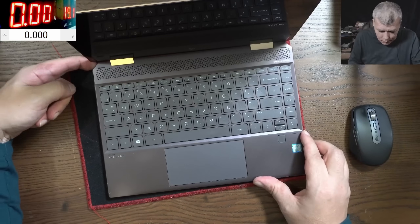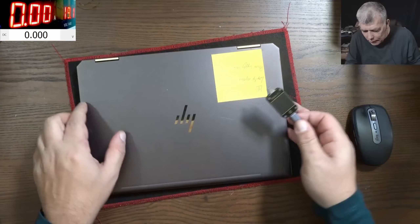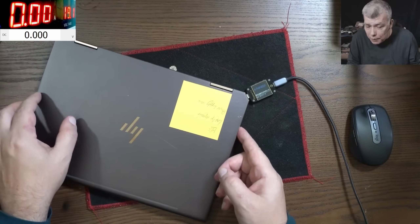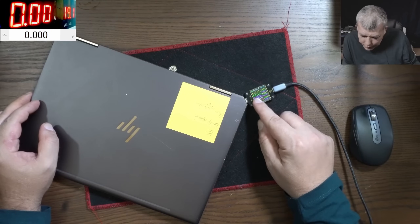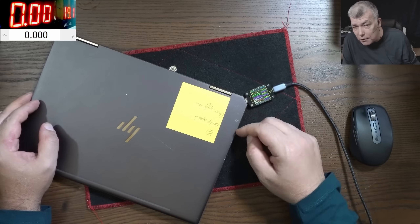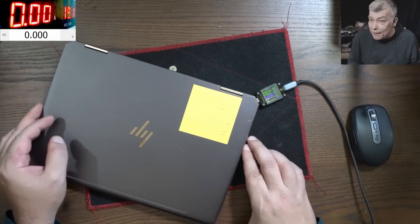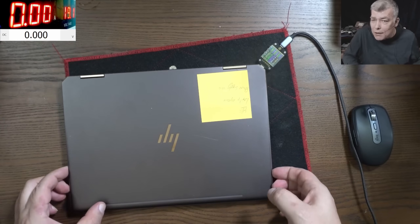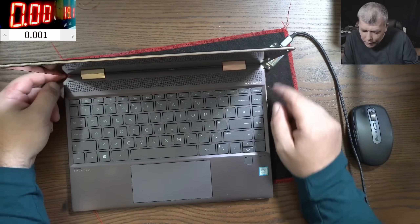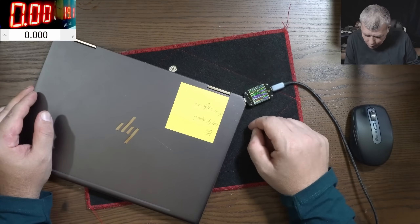Pressing the power button here on one corner and it's not doing anything. Let's plug the charger - it's USB-C. The meter is coming on: 4.8 volts, 0.8 amps. This is weird - it's kind of dead. It's taking 800 milliamps and I'm curious what is taking this power. Also it's not negotiating the voltage - usually it should be like 19V.